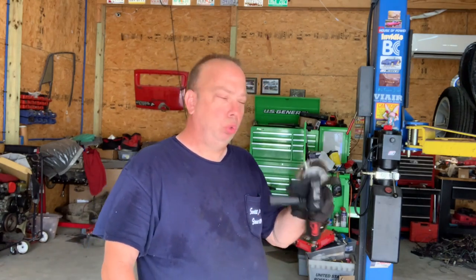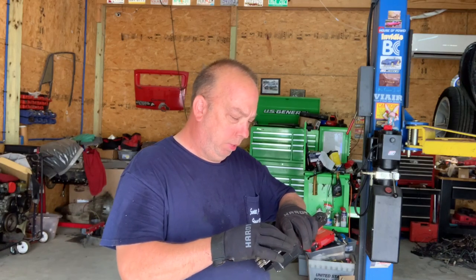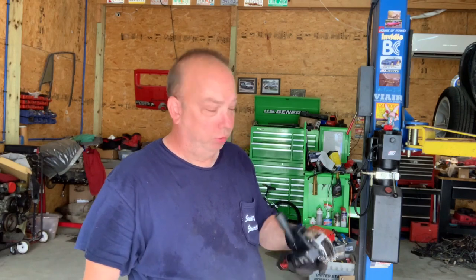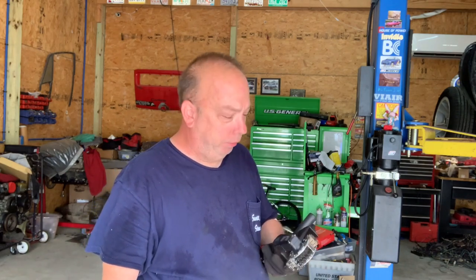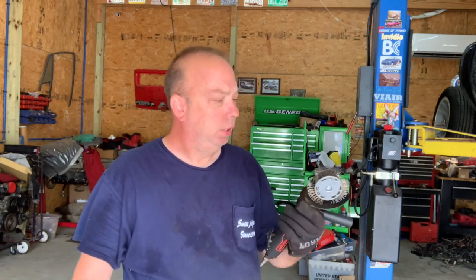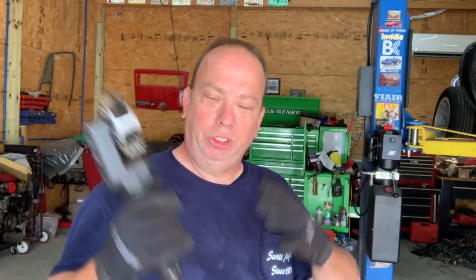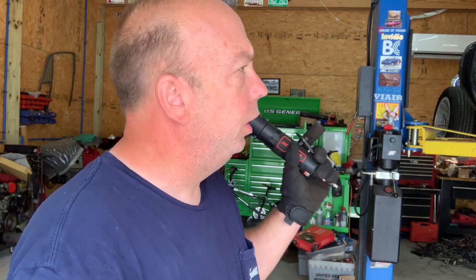But I got this new tool from Snap-on. I'm not promoting Snap-on. I'm not sponsored by Snap-on, unless they want to sponsor me, that would be wonderful. But I highly doubt it. So there's this wire wheel. It's very dangerous. Very. Make sure you wear a full face shield and long sleeves. The wires can poke you. So I was testing it out, and it's very impressive on rust.